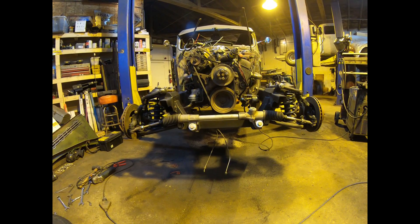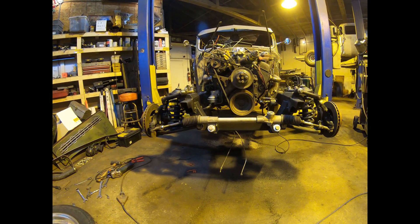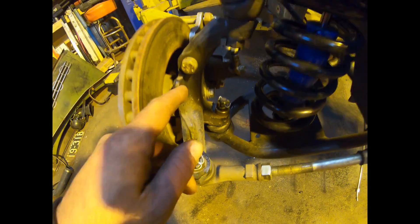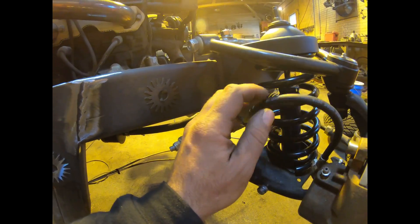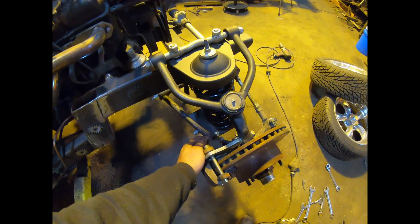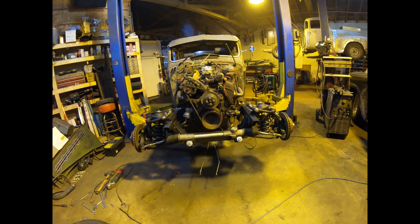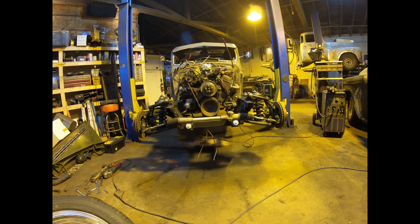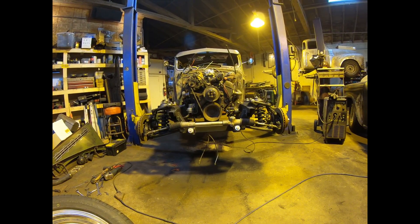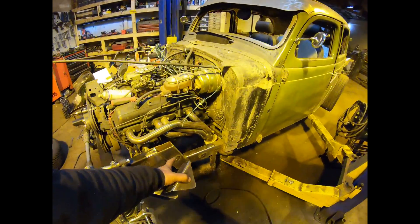It's a fresh day - got this thing wrapped up to the point where it's at. Last Friday got everything painted up on the front rails, everything assembled - the steering rack is on, everything tightened up properly with cotter keys, ball joints, tie rod ends, calipers are back on. Relocated both of the brake line brackets - before they were up high and were probably hitting the tire. They work really nice now, full lock-to-lock. You can tell the big difference from how it was when we first looked at it - the cradle is way lower and everything actually looks correct now.